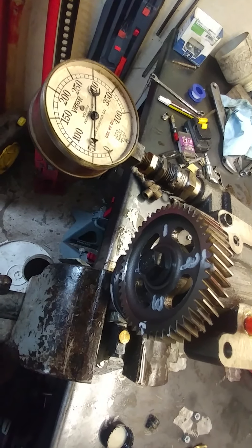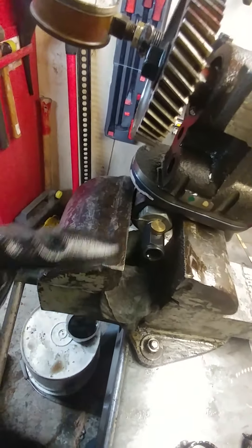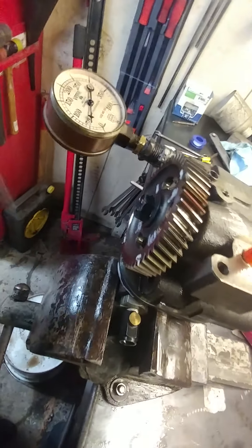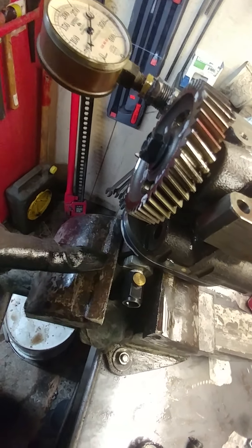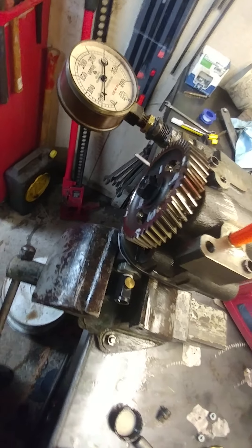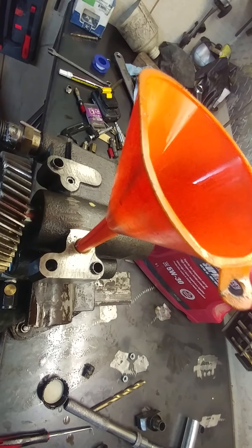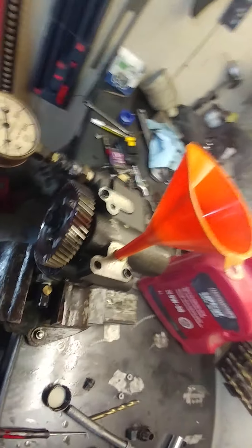And not deadhead the pump. The IPR has the air fitting inside. This is just a valve in case this one releases, so before I take it off I'm going to bleed off the pressure from there. It might be leaking a little bit but not too much, and there's oil in it.